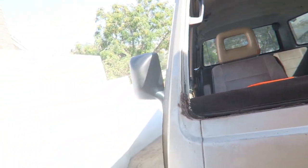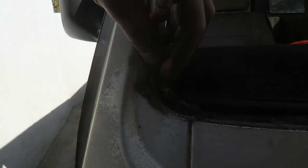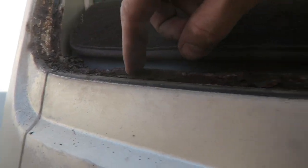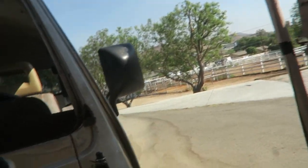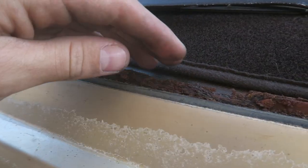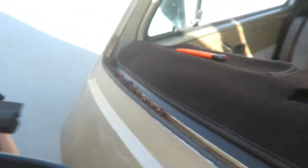Windshield is out and the rust is not looking too hot. This one we kind of didn't know because it's just a little bit showing, but upon further inspection, I mean look at this. You can see with that harsh lighting — it's pretty bad. It almost ate all the way through the first layer where the two pieces of metal were seam welded together. Also rust along this whole channel on the bottom down here. But the major rust is over here, of course. It's just a bummer finding all the rust along here. We'll vacuum this all out and get a better look at it.